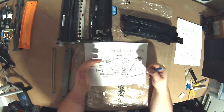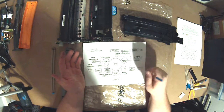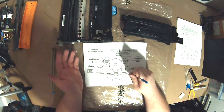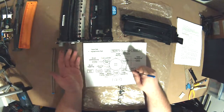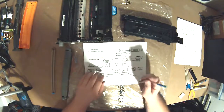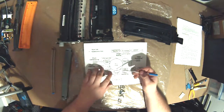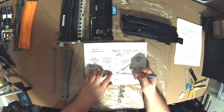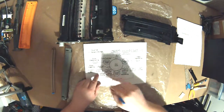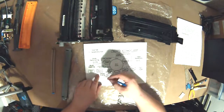So far, you get your paper from your input source, that would be your pickup assembly, which we talked about earlier, or paper input unit. So input source they're referring to as the tray. Paper input unit is the pickup assembly we showed. Registration assembly, which I don't think I'm going to have a video for you guys. I'll have to look around if I have a spare. But basically it just squares the page, because if it picks, sometimes it gets a little angle on it. That goes through underneath the print drum, which is this assembly, where the transfer roller and static charge pulls the toner particles off the drum and onto the paper. And that gets fused. And then if you're duplexing, you divert it, and that will go back around again, get re-put through the paper input, and get reprinted on the other side, fused again, then it goes to the output.